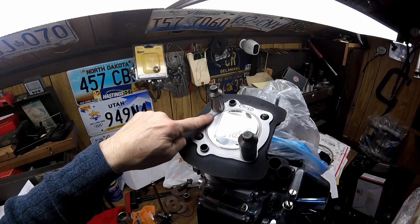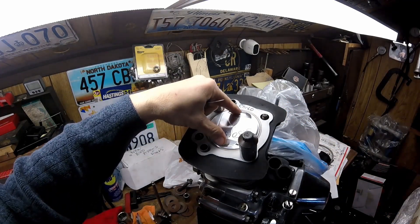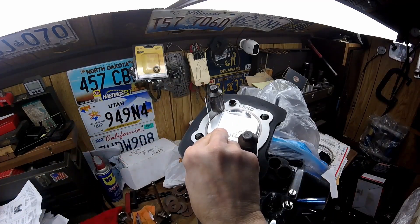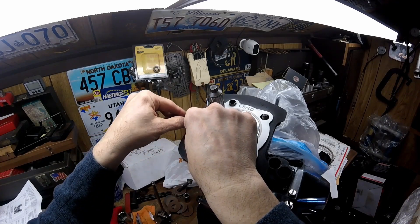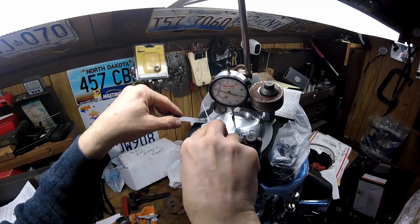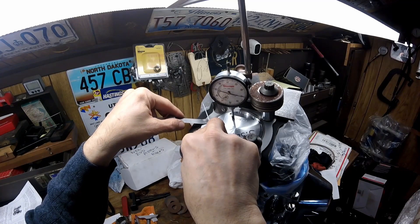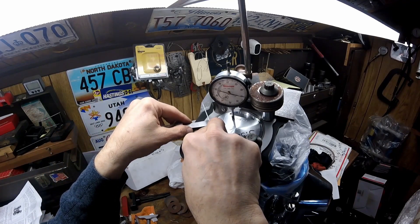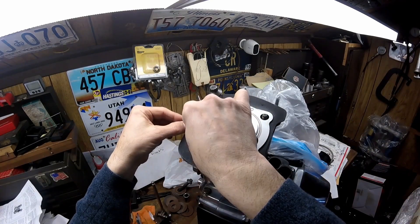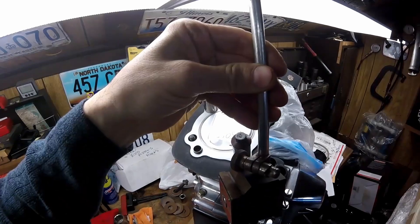To decide whether your piston is out of the cylinder or not, just feel across it — I can feel the piston is sitting slightly higher than the top of the cylinder. Get a straight edge and check it right at the wrist pin, because the piston can rock elsewhere. Take the straight edge across the top, then put a feeler gauge under it. Five thousandths slips in and out freely; six thousandths has a lot of drag. So the piston is sticking five thousandths out of the cylinder.